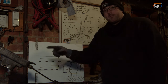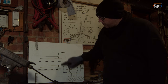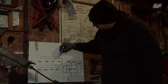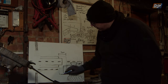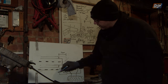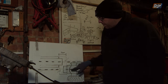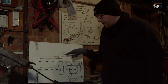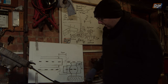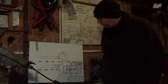When you look at the other end, there's no offset — it's properly designed, dead straight, with all the flex you want just in the fitting on the end. We're using a lot more of that tolerance than Audi had to play with. The simplest thing is just to make a little offset adapter piece — only have 7mm — so the plan is to cut a piece of solid steel about 7mm, drill two holes in it, and back-weld through the sides. I can't weld in through that edge because we come up right against this sleeve, but I still have to take more off the lever to make this fit.